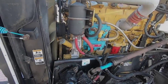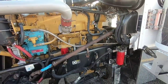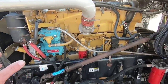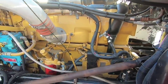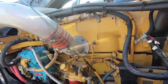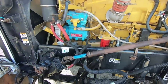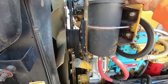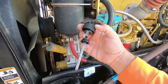We're checking everything out before we take off, got about 150 miles to go today to get to a truck stop and get a parking spot. Looking at the engine first, I'm looking for oil leaks, anything leaking, anything that looks out of place. I try to keep my engine as clean as possible. Oil looks pretty good - no frothy bubbles or anything in the oil, so that looks good. There's a little leak here but it doesn't drip on the ground, so that's serviceable.